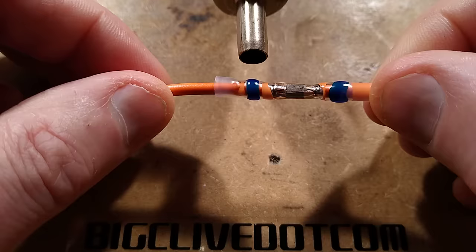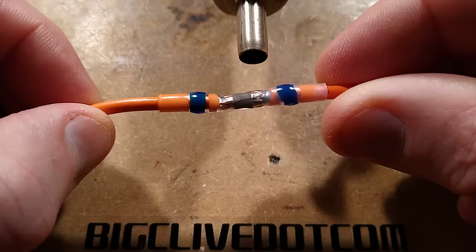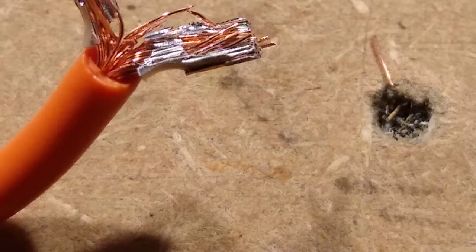Let's do the other band here. This is the other hot melt glue band that is going to basically grip onto the wire and seal it against water ingress. That looks pretty good - that worked relatively well. But what really matters now is whether that solder in the middle has actually flowed properly. Let's cut the joint open and find out.